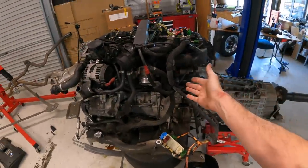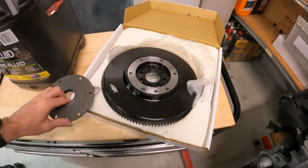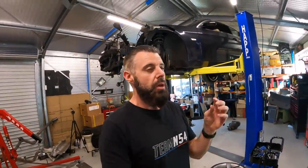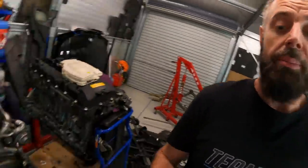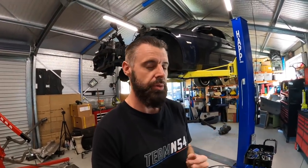I could just drop that motor into my car, but it seems silly taking mine out when it's all working. So what I've gone for is an M-Factory eight-bolt DCT flywheel. You can get an eight-bolt DCT flywheel direct from BMW — there were a very small number of cars in late 2008 that still had an eight-bolt flywheel with a DCT, so there is a BMW part number. But they're quite expensive and hard to come by, and in Australian dollars it's about $1,800.